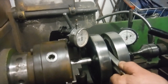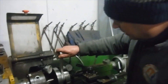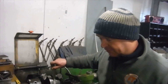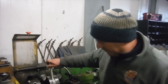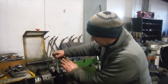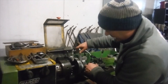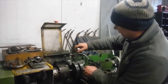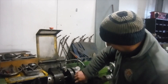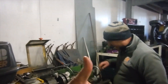That's about as good as you could wish to get, so I'm pretty confident this crank will run nice and smoothly in its main bearings and Roger should have a new lease of life. The old big end is a topic to discuss on its own — I've never seen anything like it before; some very clever, unusual engineering went into salvaging it. But we've got a proper brand new item in there now, oilways lined up and blown through, and the relief valve on the Redditch flywheel assembly has been checked, blown through, and cleaned. This is all ready to go back into an engine and probably do another 60 years.